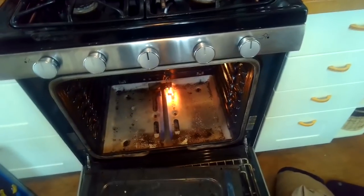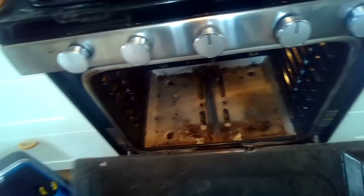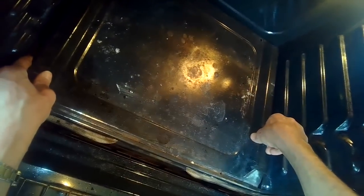This will probably take you about 15 minutes total. We're going to turn it off and put it all back together. We take the heat shield — the bottom plate — push it in at about 45 degrees so the front lip goes down into the frame first, then set the back end down, making sure it's all nice and flat. Then put those two screws in to hold the back plate down. Gravity is really enough to hold it, but it's good to follow the reverse of how you took it apart.